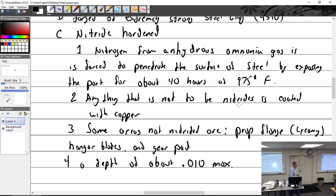Now you can see that if the nitriding depth is a maximum of 0.010 — and really more like 0.005 — it makes sense why Lycoming would say you can polish to three but not go to six without re-nitriding. Now they want you to re-nitride all the way through. As for cylinders, most manufacturers nitride their cylinders now. If you bore a nitrided cylinder ten thousandths over, you no longer have a nitrided cylinder — even if it's still labeled that way.